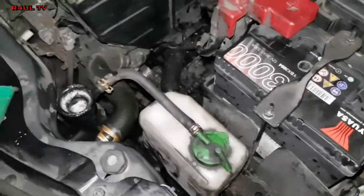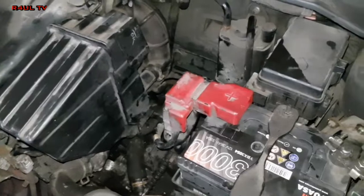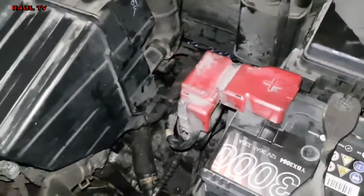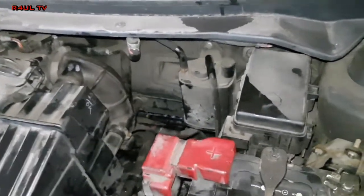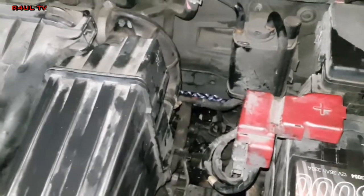The car is running — just going to re-top it up with coolant and that's it, all done. That's how we replace the clutch. I know I couldn't show you some of the bolts properly because I couldn't get the camera in there, but I hope I explained it as best I can. If you're doing it outside on trolley jacks, make sure you take that rear mount off because getting the starter bolt off is really hard. That's it guys — that's how we replace the clutch on a 2010-2012 Suzuki Alto 1 litre petrol. Like, share, and subscribe, hit the bell button, leave a comment, and I'll see you guys soon.